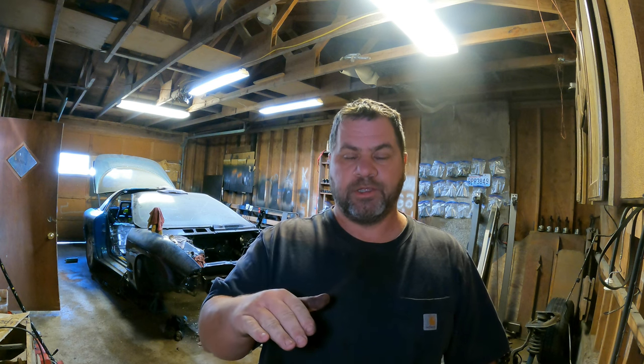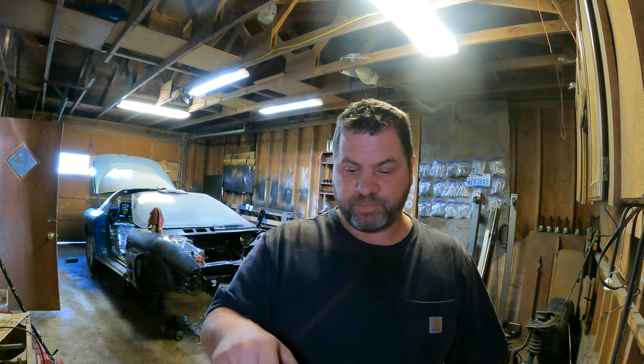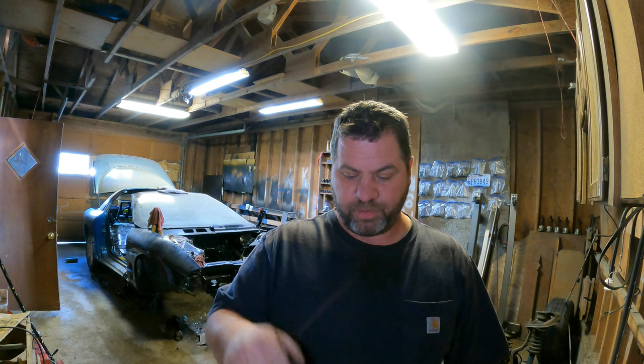Easy outs are not the good. I pre-drilled the bolt, put my easy out in there. No good. It's not coming out. So what I did was I took a Torx, like a T10 or T15, and I've hammered it into the bolt where I drilled the hole, and I'm gonna see if I can impact it out now. So let's see if that works.